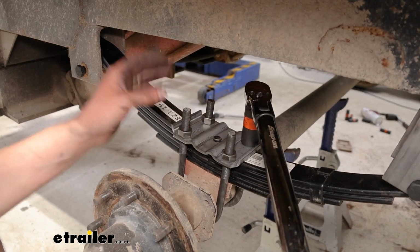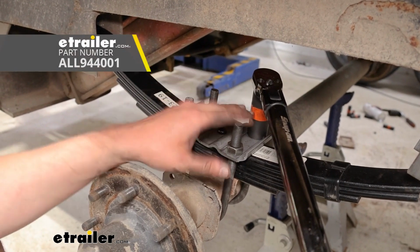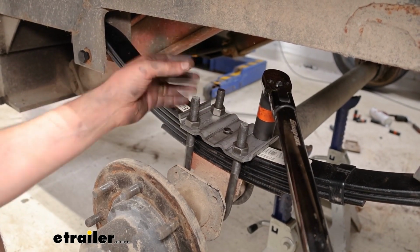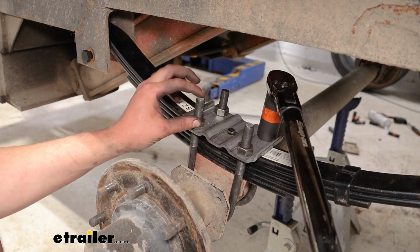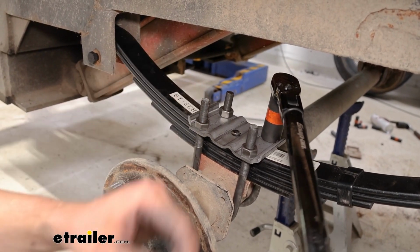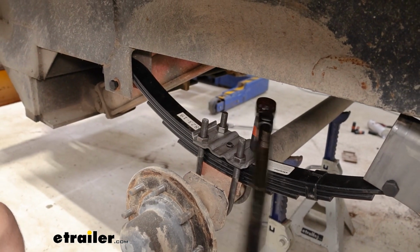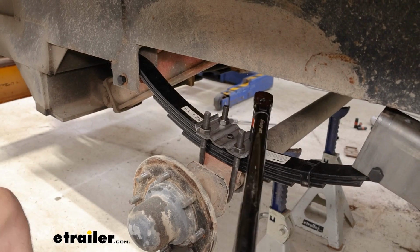And then we're going to want to go through and torque to spec. I do try to just kind of jump from side to side until we get to our torque, so that way we've got equal, or at least somewhat equal, lengths coming up out of the studs. And just double check the instruction guide for that torque spec.